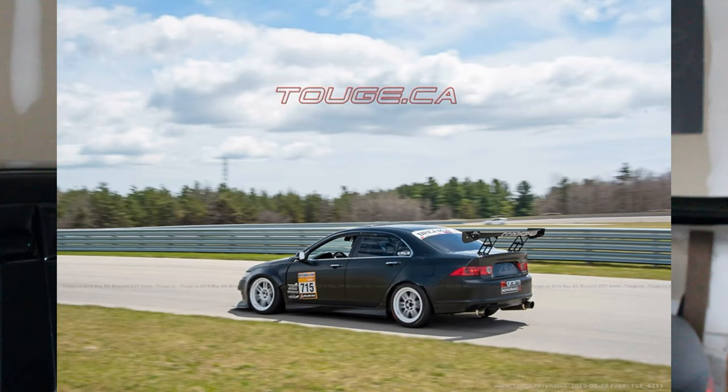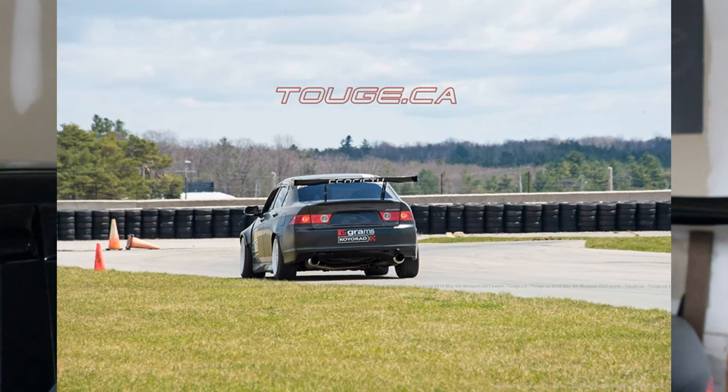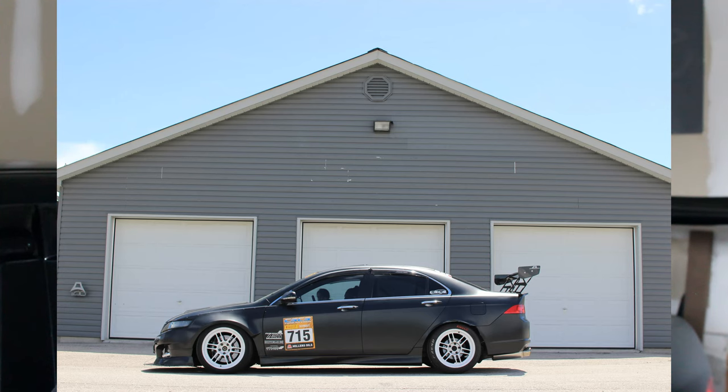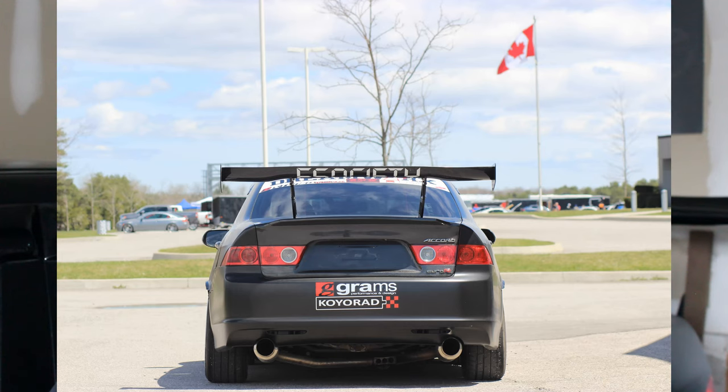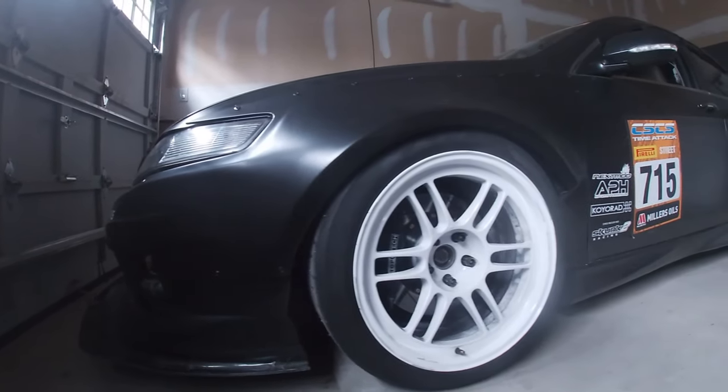This video is going to talk about the setup for the car this year and what we were actually able to accomplish over the winter. Everyone knows the front camber has been my excuse for why I can't do my best on the track. Now with the front camber kick ground off, we were able to get negative 3.9 on one side and negative 3.6 on the other — that's just because grinding something off won't give the best result, and that's the minimum camber the front will allow right now with the height and weight distribution change.